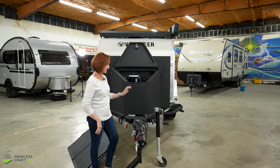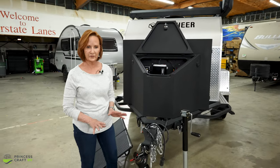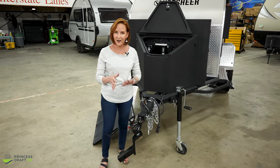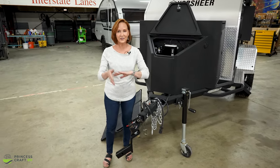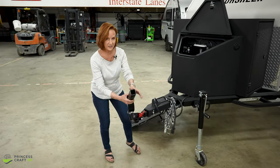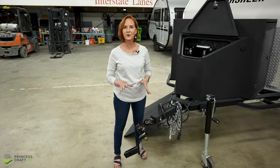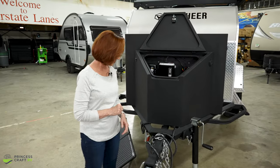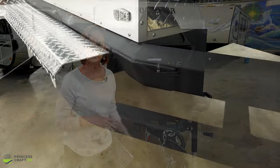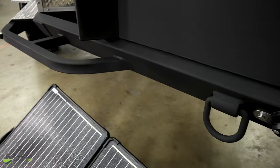In front of the box is the standard chain seven-way plug. But look at this — this is a max coupler, a 360-degree rotation so that the trailer does not have to follow your vehicle; they can move independently over rough terrain. That 360-degree rotation all the way around is very helpful if you want to go off the grid. One more thing to note: this 30-degree angle on the frame gives you more surface area, so you get a lot more strength when you weld the cross members.